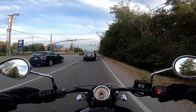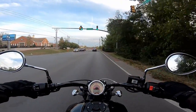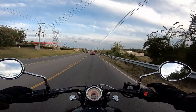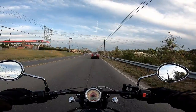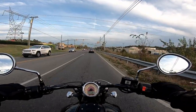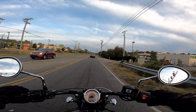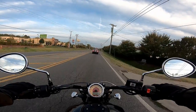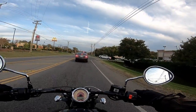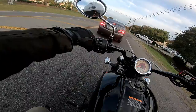People have definitely taken this bike well past 100 mph. I don't really live in the triple digits, so it does everything I need with a lot in reserve. One thing worth mentioning: at around 80–85 mph I noticed the bike would shimmy a little. I'm not sure if that's related to my setup — when I got the bike the handlebars were a little below midpoint, and after raising them about an inch the bike felt more stable and that shimmy was greatly reduced, if not completely eliminated. Let me know in the comments if that's normal for this type of motorcycle.